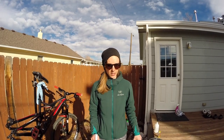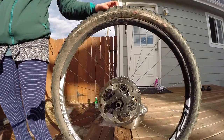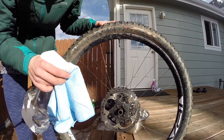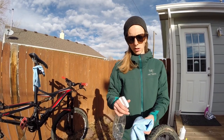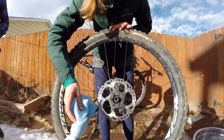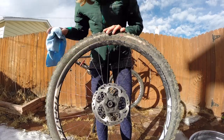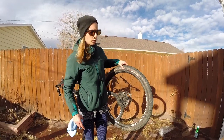One of the last steps is wiping down the rear brake rotor with a little alcohol — it might have gotten a small amount of spray during the cassette cleaning. Using a completely new and clean rag, I'll spray some alcohol on it and wipe the brake rotor down — just the outside and also the inside a little bit, moving in the direction the brake pads would travel around the rotor. Now I'll set this aside, let it dry a bit, and put the wheel back on at the very end.